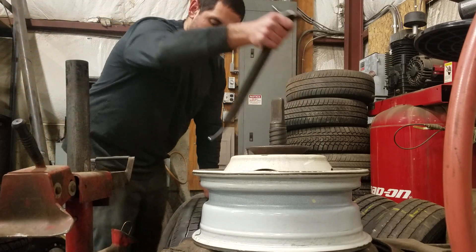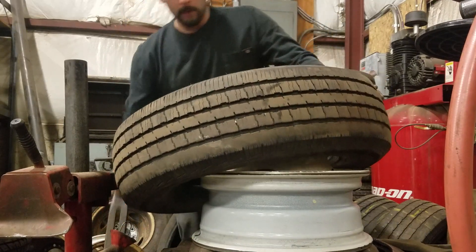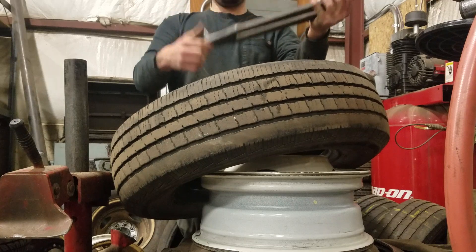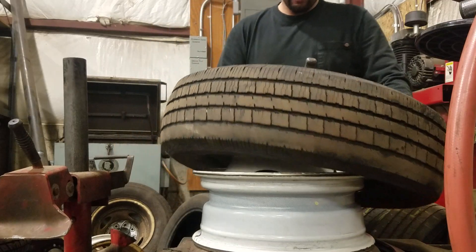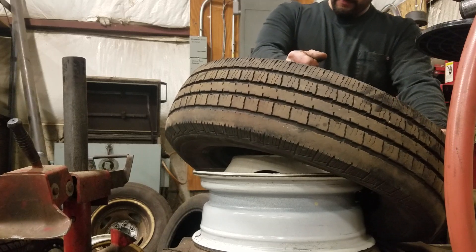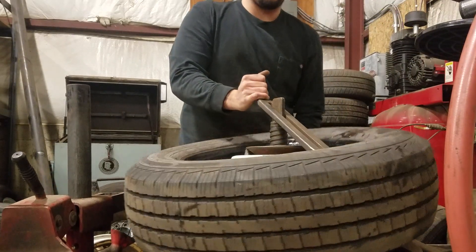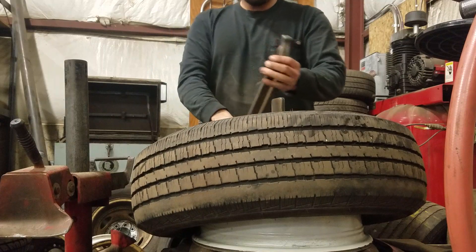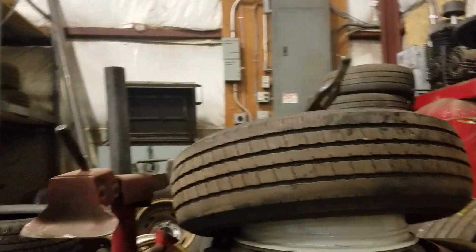Making sure I put the worn side down, trying to prevent this tire from getting destroyed before too much tread's been worn off. Instead of using the grab hook for the bead, use this side — this side goes towards the rim, kind of just rides on the lip of the rim. Set the tire on there, start the bead as far as I can, hold on to the bar, hit the pedal, and it pops the tire on. Let it spin back around, pull it out a little, twist, set it back up on the rim so you can see what it looks like.